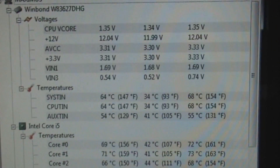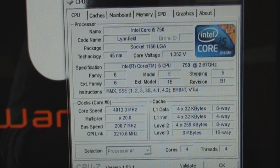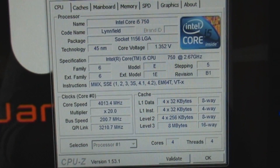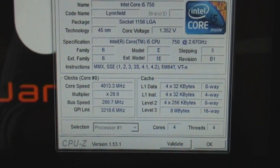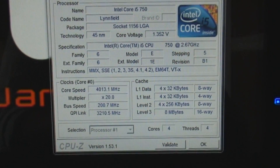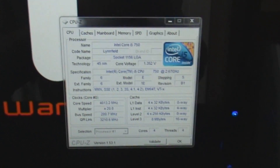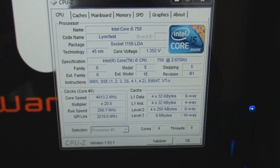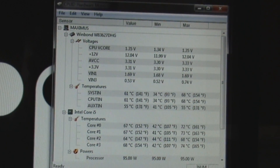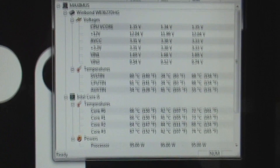For those of you who want to overclock your i5, these are pretty much the voltages and settings I used. Everything else in the BIOS is pretty much set to lower voltages — the VTT voltages, PLL, and all that stuff. Memory is set to 1.65V, everything else is on auto. I turned off C-step and the equivalent of V-droop, since it's an ASUS board. Hyper-threading is actually on — wait, no, the i5s don't have hyper-threading, so there's not even an option for it. Thanks for watching.